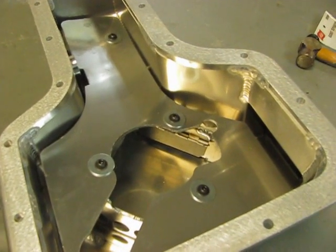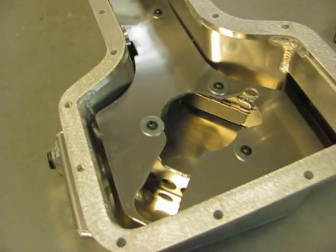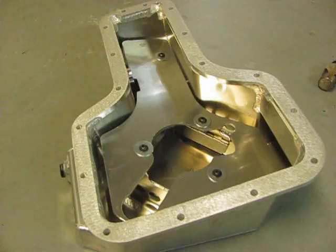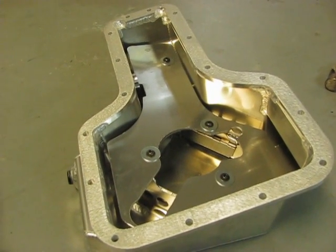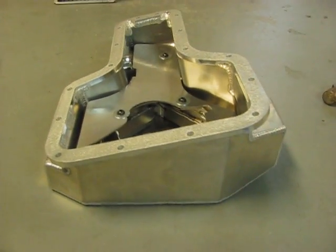This should work better. I'm going to check the dipstick clearance today to see if I need to get out the grinder and do any work to the baffle plate. But I've already test fit the Moroso pan — no trimming to the windage trays required. Everything seems to clear fine, bolts right up. So I think this is going to be a worthwhile improvement.